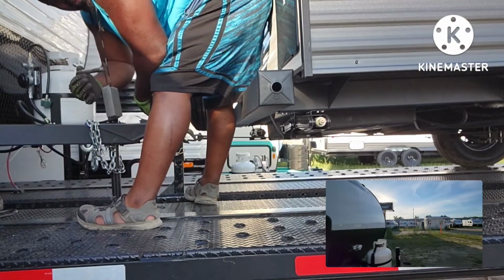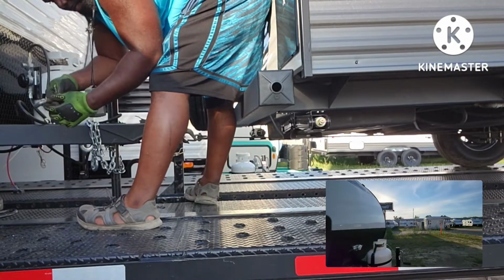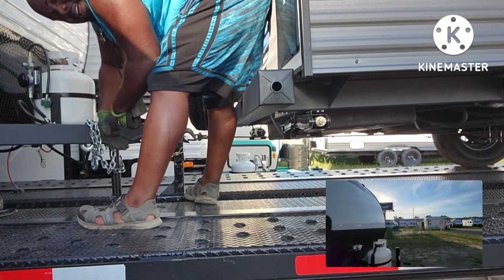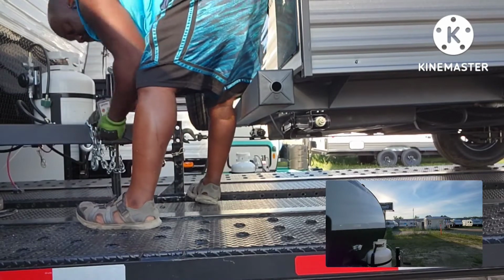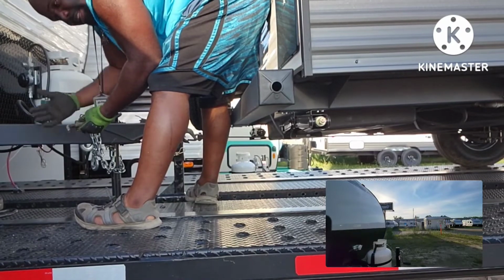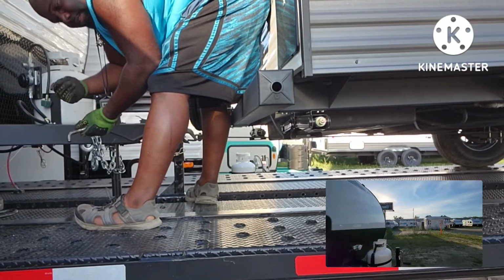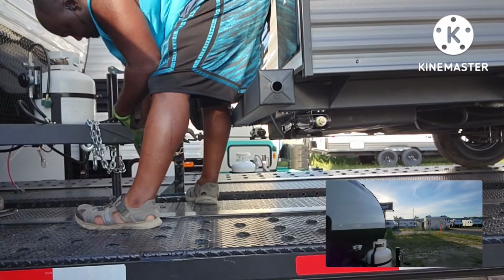Another thing is when you put these pins in on your stands, make sure the hook end is on the side with the cable, along the side the cable runs. Because whenever you pull in that cable, if that cable bounces, it can snag the pin and snatch the cotter pin out, and this could just vibrate on out from the ball stand.